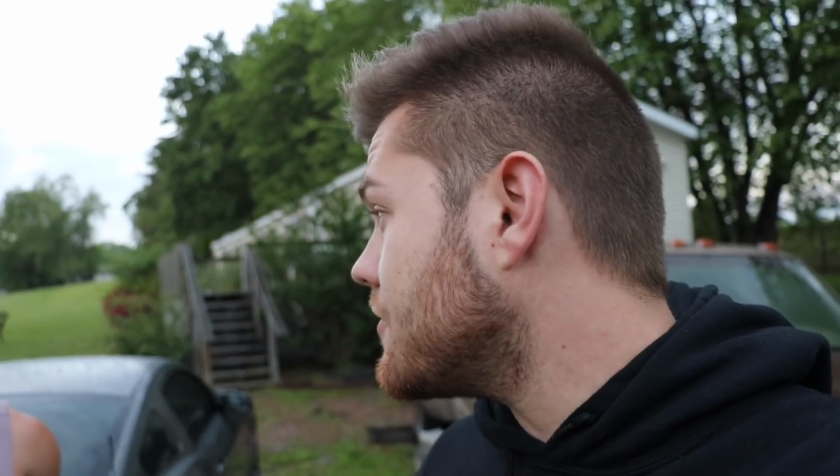This car on 21 pounds would probably go 1250-ish. I'm not going to say definitely, but more than the 6R80 car, because obviously it's a stick shift car with a TR6060, so he just wants to crack 1,000. You don't want to turn it up too much past that, because 1,000 in a stick car is already too much. It's going to be crazy anyway.